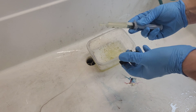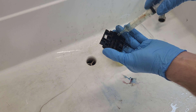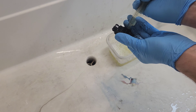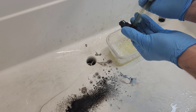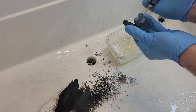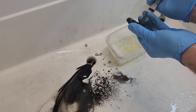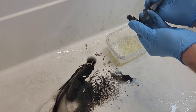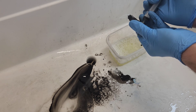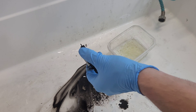Okay, I have my syringe ready, filled with the solution, and I'm just going to place it over one of the ports here and try pushing some through. You can instantly see black ink coming out — so we're on the black nozzle. It seems like our printhead is very good. My sink is plastic so I need to do some extra cleaning on the sink after I'm done, but let me just rinse that off real quick.